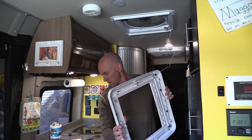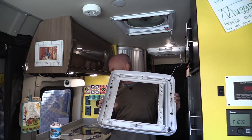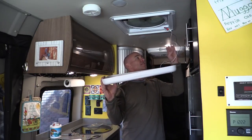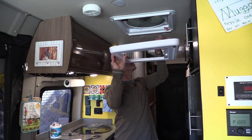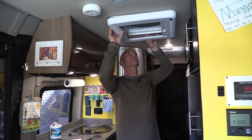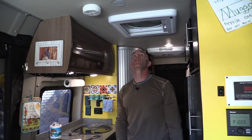Step six: assemble the Max Shade shroud to the adapter. Position the Max Shade with the open side towards the controls — this is the open side, these are the controls — and line up the flanges and press firmly to lock it in place. I do have to worry about these wires up here and not getting them pinched. There's conveniently a cut-out on that side, so I'll take the wires to the outside of the flange. Hold them in place — out, out, out — and there we go, it's pressed into place.